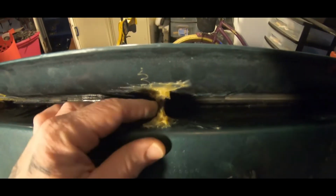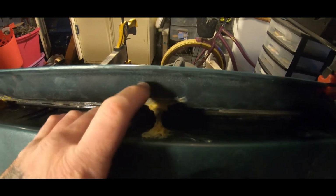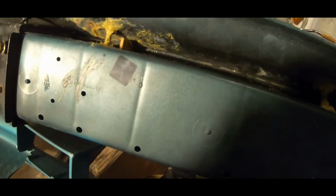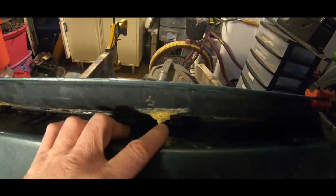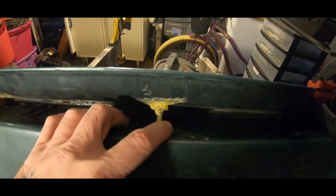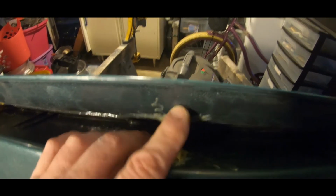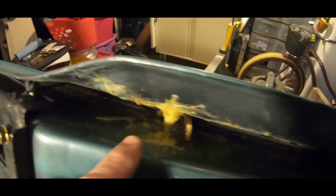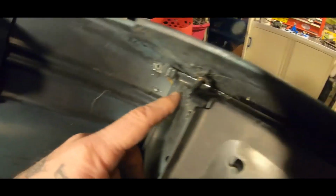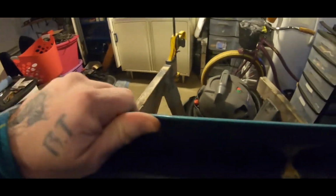I go back and take a bolt or a screw and put it in there so that it's just sitting against this part and this part of the bumper, your actual bumper support and the actual bumper itself. And I'll put Permatex around the bolt. I'll coat the actual bolt so that no rust will form on it. And then I really put it together on these two places. I also do it here. I did it here. And I did it back in here. And I did that so that this thing would have support like it's supposed to.